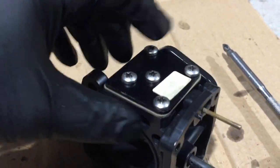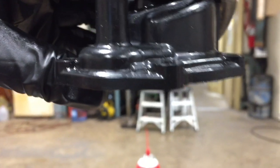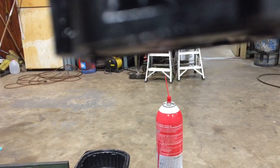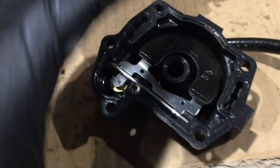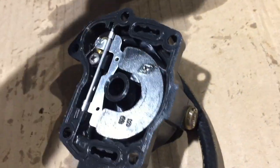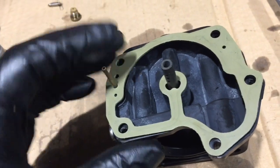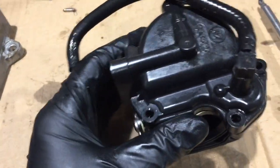I went through and put the gasket back on, put the screws back in — that's ready for the bowl to go back on. I'll show you what I was talking about with the float level. Right now it's pretty much level with the base; you can see it sits down this way a bit lower. When you flip it, it becomes level — that's what you want. Make sure everything's moving good, your floats are in good shape, then take your gasket, put it on there, flip your bowl back over, drop it down, and put your screws back in.